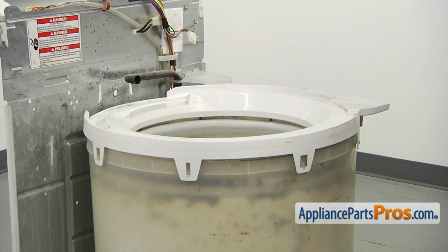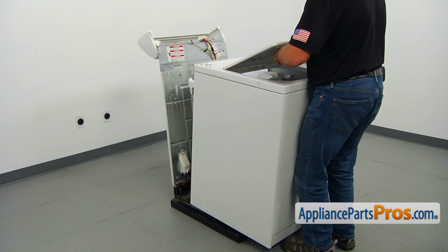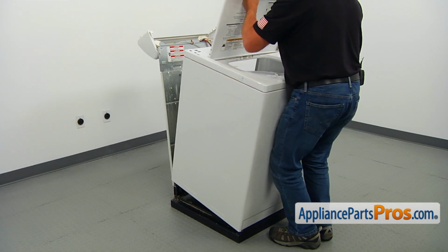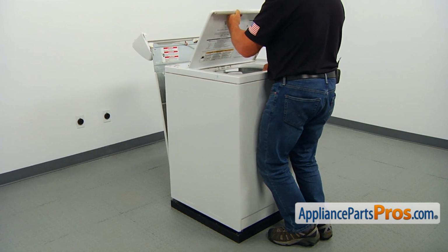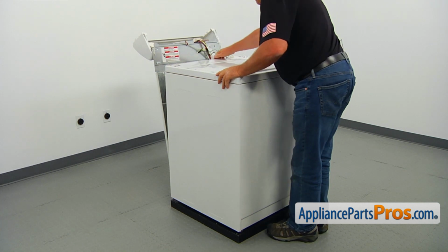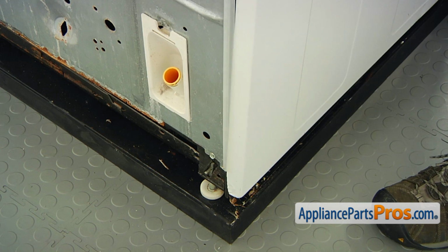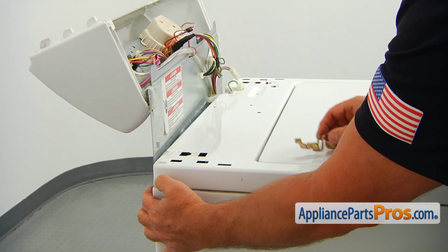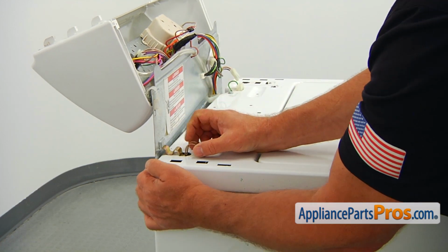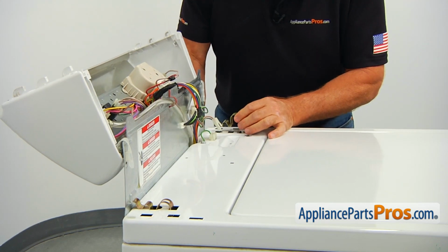Open the lid, grab the cabinet through the lid with both hands and bring it to the front of the washer. Slide the front edge of the cabinet under the base and lower the cabinet down so all 4 tabs go into the slots. Push the rear panel in so the cabinet is flush with the rear panel. Hold it with one hand and install the retainer clip with unhooked end inside the rear panel and push it down to lock in. Repeat the procedure on the opposite side.